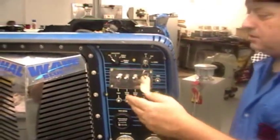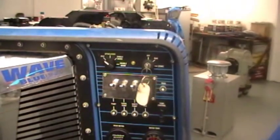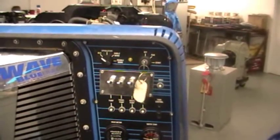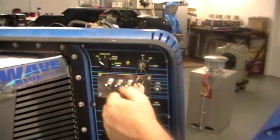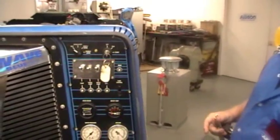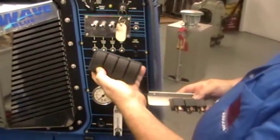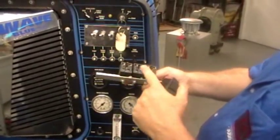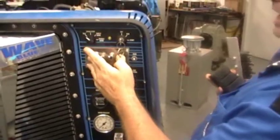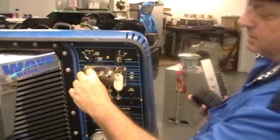These switches may not look that great, but we can get these at an auto parts store for around six or seven dollars and they're 50-amp switches. In the middle of the night, out of town, if your switches go out, it sure would be nice to just go get a local switch and put it on there and finish the job. Here are the original switches — they're nice, but you just can't find them local. They were used in conjunction with relays, so we eliminated the relays and those switches and went with high-amp, 50-amp switches.